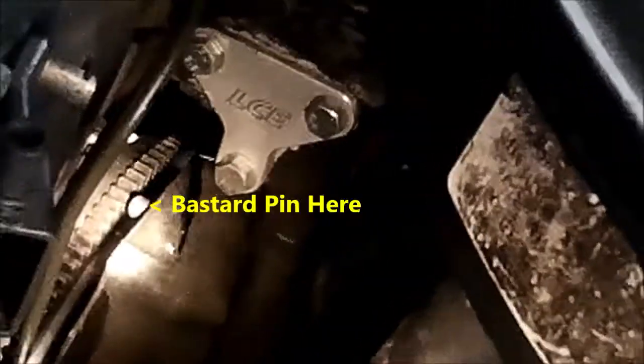I'll see if I can't zoom this in. See that little knob sticking out right above the gear? It's a locator pin. There's the flywheel and the clutch pack. Let's go around this side. Yeah, I can't quite see it on this side. I know it's there because I have problems getting it off. But that's the booger that's holding me up, at least. That one up top. Because I decided to pop up here and have a look and see what was going on. And there's that pin, and I can see the hole just below it.